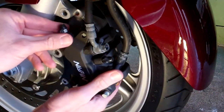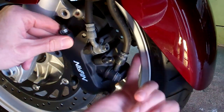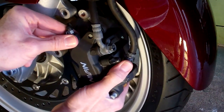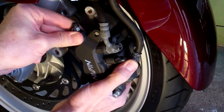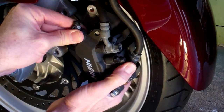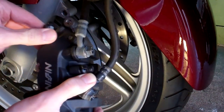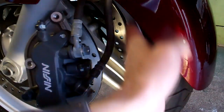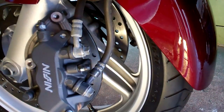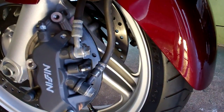This is nothing in comparison to how close some BMWs are — you can't even fit a slice of paper in between those two surfaces. But if you keep it very parallel with the disc, you'll see that I'm just about touching the rim right here when this thing lets go and wants to come off. So it's not a bad idea to slide a little thin piece of cardboard, or best yet, just put some tape on there to protect the surface.